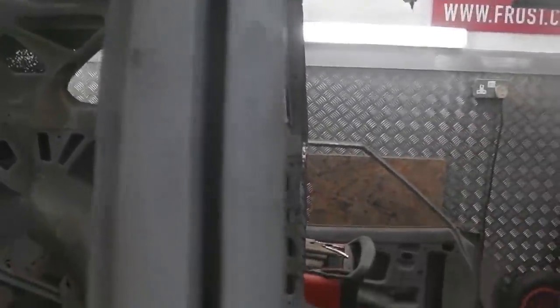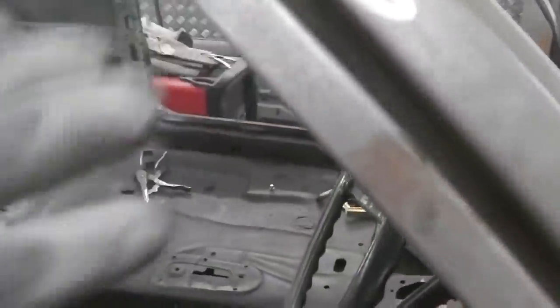And there's our door gap back in as we put the tension into the back end and jack this front brace into that. Now we can lock it in with the pliers just there, just nip it up, and we'll just then start doing our door gap measurements and just see how the B pillar does its corresponding measurements. Check that aperture again on the windscreen this side, and then we can put a few tacks in for now and then start building up that other structure.